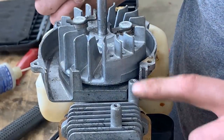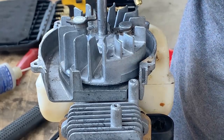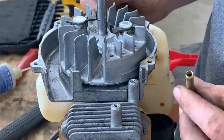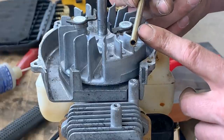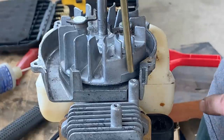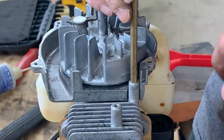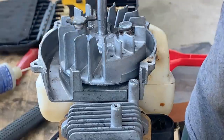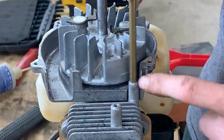Okay, I tried drilling it, doesn't work. For whatever reason, my drill bit doesn't wanna budge there. So I think I'm gonna try another method of extracting screws, which I saw somewhere on YouTube. They were explaining how to do that with copper tube. I don't have copper, but I have a brass tube, which I'm gonna cut a little piece of. I'm gonna put it there, and then I'm gonna try to weld inside directly on the screw. As you know, on copper and brass, the weld won't stick. So I'm hoping to be able to build up some weld on the screw.